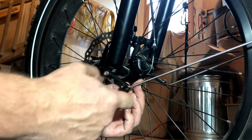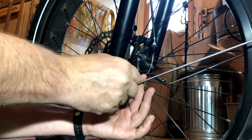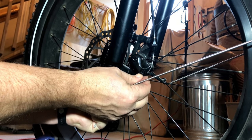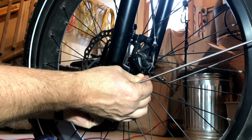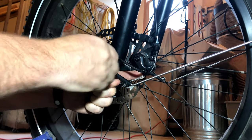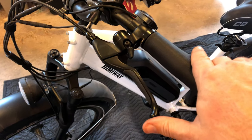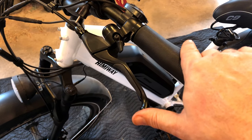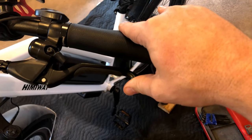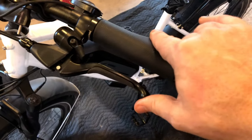To take the slack out of the cable, we're going to loosen this bolt with a five millimeter Allen wrench, about a full stroke or so — this allows the brake lever to move on the cable. What we're going to do is pull the cable up, not all the way to lock, but bring it up to lock and then pull it back a little bit, and then tighten it back down. After making that adjustment, you'll notice the handle only comes back and doesn't hit the grip. Barrel connectors are fully in, so we still have plenty of adjustment coming out, which is what we want.